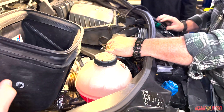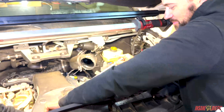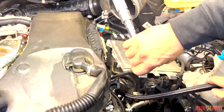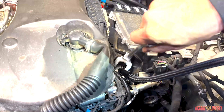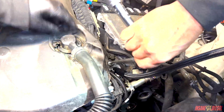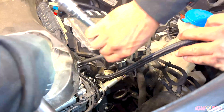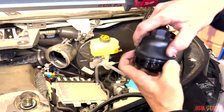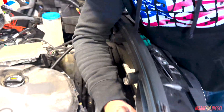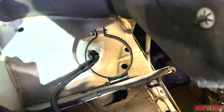Just kind of work it up — that's not bad. Now that we're done with the intake, it's actually not bad at all to get this in here with a one-inch crow's foot, and spin the oil filter housing cap down. 18 newton meters — you can feel it drag on the o-ring until it touches and hits. So I just snugged it against that. The intake will come in here, up underneath your intake next to your overflow on your antifreeze reservoir, and right down to the bottom of the filter to the inlet.